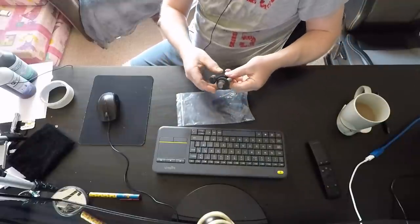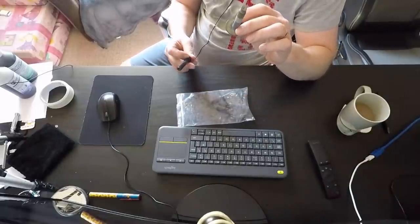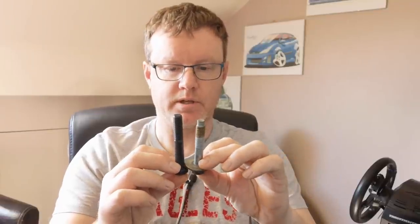My plan involves these — steering rack bolts. This is the standard one, and that one is 15mm longer. The plan is to raise the steering rack on spacers, using a series of washers to incrementally raise it while taking bump steer measurements. I've never seen it done before on a Fiesta. I'm hoping the steering rack can be raised up to 10 or 15mm without running into problems — the steering column is telescopic. If that all goes to plan, the ultimate goal is to have a much better handling Fiesta, far superior to a standard one.